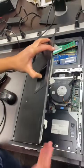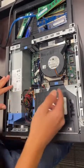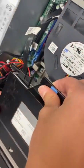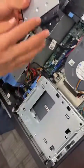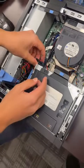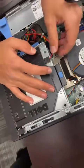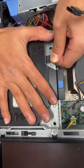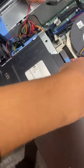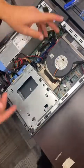Lift the lid and put it somewhere safe. In this model you don't need to disconnect the DVD drive first — you can just grab the handle right here that has the blue indicator, lift it a little bit, and slide it to the opposite side. Or if you prefer, disconnect it first: pull the SATA cable out gently, then the power cable the same way, grabbing it by its head. Then slide the drive out and put it somewhere safe.